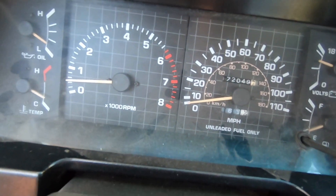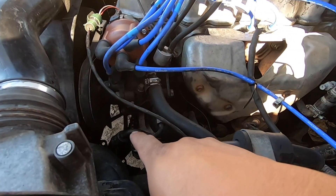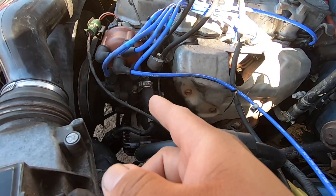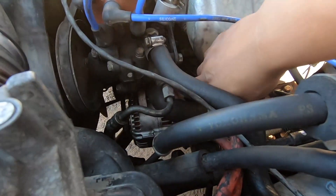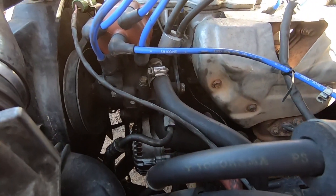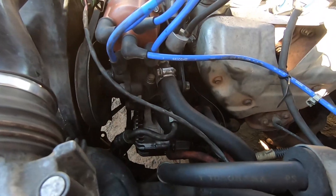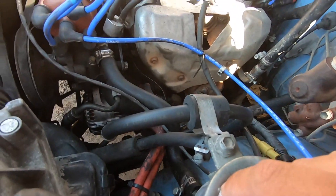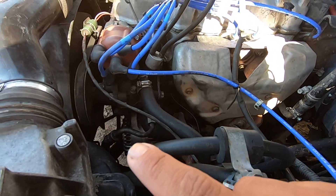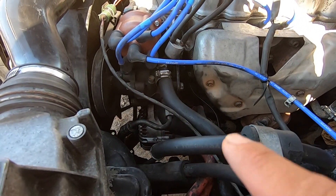The voltage is pretty good now, even with the lights on. It's still a little shaky because we need to adjust the valves — that'll be in a couple of videos. So to summarize: we had to bore out the pulley, cut that little extra piece off the bottom bracket, shave off the top mount so we didn't have to bend the stock bracket, upgrade the cable since the stock one is thin, and remove the lower radiator hose to fit the new alternator. The stock belt fits, so you don't need a new belt.